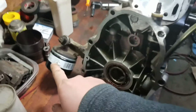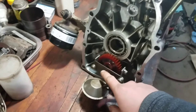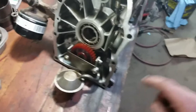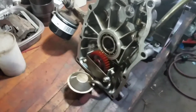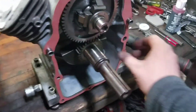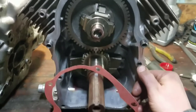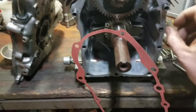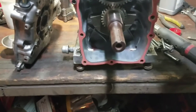Got my sump cover prepped. I have the oil filter filled up with some oil. I stuck some Vaseline inside the rotors for the gear pump so that doesn't run dry. I put my new seals in — the bearings are nice and tight, no wobble. So that's all primed and good to go. I got my O-ring in the block right here. There's a smaller O-ring for the older blocks that predate May of '97; after May of '97 they're a little bit bigger. There's usually a paper in the gasket kit to let you know — that's what seals up your oil gallery.